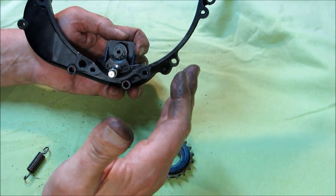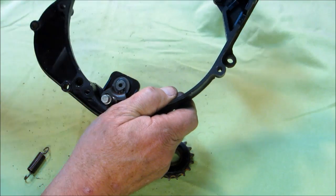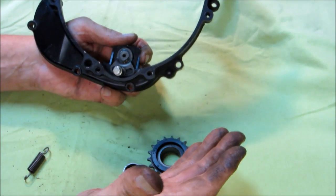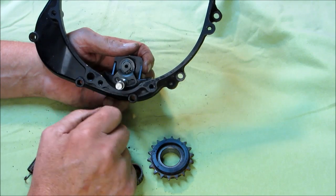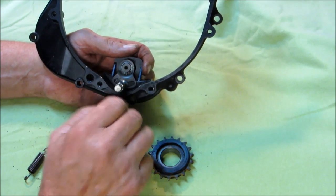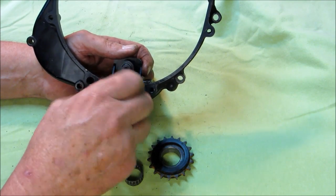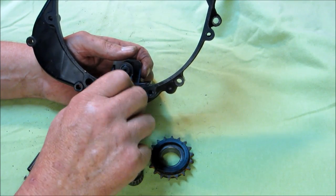Now the question is, why do I need to replace my doohickey? What's wrong with the old doohickey? Well, there's not much wrong with the 2008 doohickey — it's pretty good. The early doohickeys did break, and I think there were two reasons why they broke. Number one is the torque value for this bolt is really low — it's not much more than just snug. I think a lot of people would come along and really over-torque this bolt, and what that would tend to do is deform the doohickey, since it's only made out of sheet metal, and then it would bend and crack.